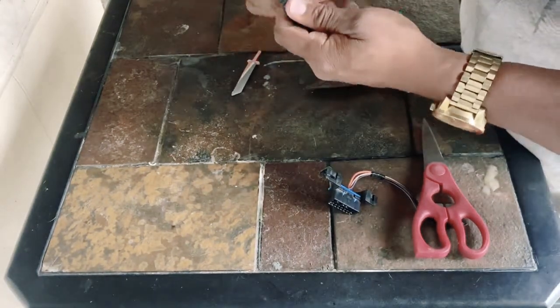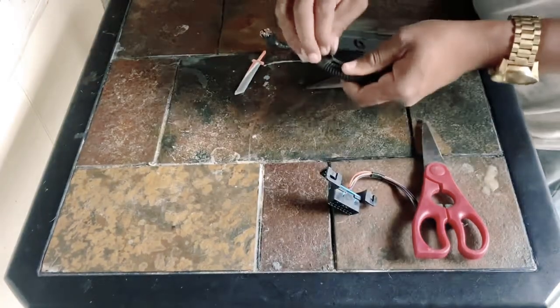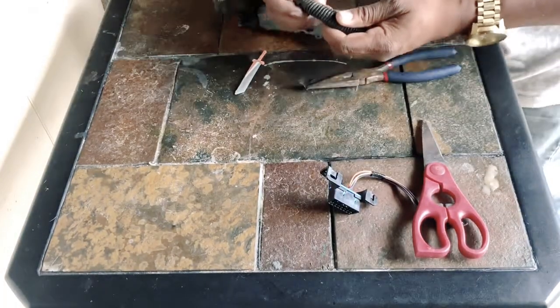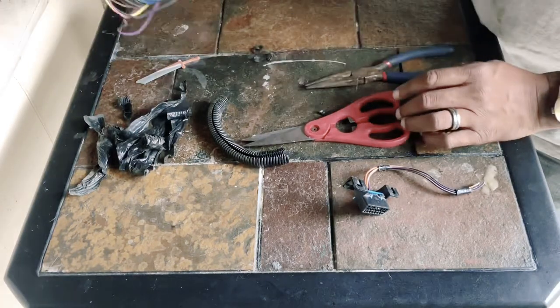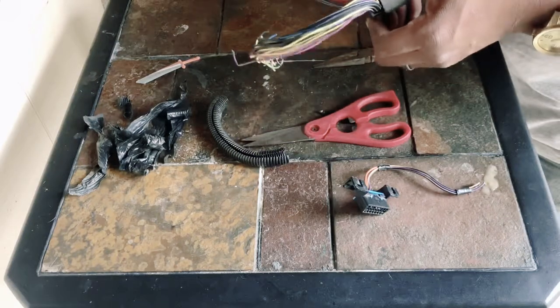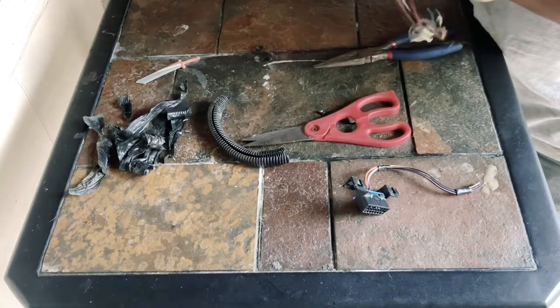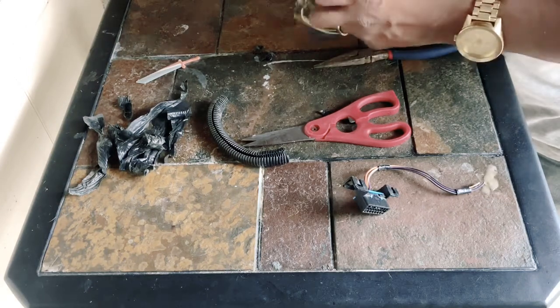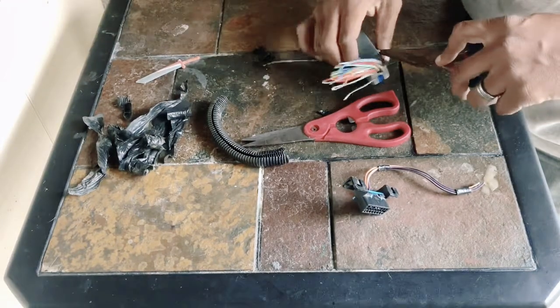You take your old harness — I cut off the car right there — just unravel it and expose the wires. With the wires exposed, you now go for the top of the PCM connector, or the back side. Take a small screwdriver; there are squeeze clips, it comes pretty easy. There's a set of six total, so be patient with it. They're fragile and the tabs tend to break.